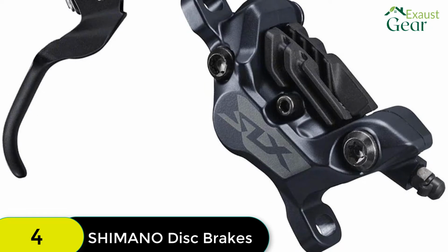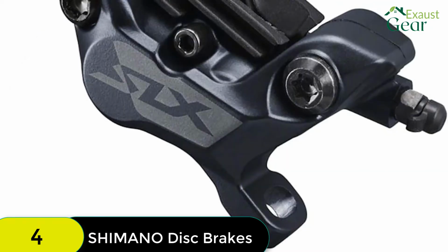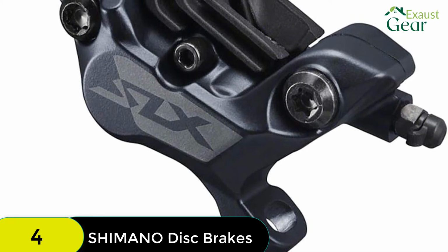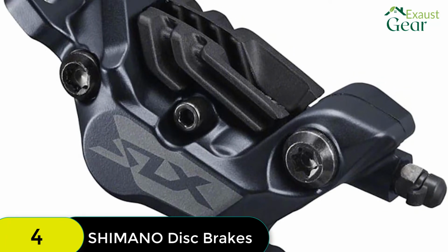SLX are excellent for normal trail rides, but at 235 pounds they couldn't handle the DH park. If you are looking for cross-country mountain bike disc brakes, go with 2-piston Shimano SLX brakes. Because if you mostly ride XC and you don't have an enduro bike or downhill bike for the crazy downhill stuff, 4 pistons is really not needed.